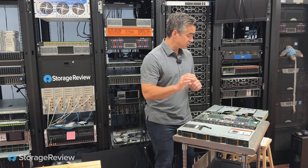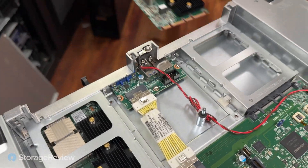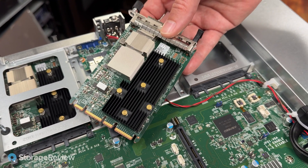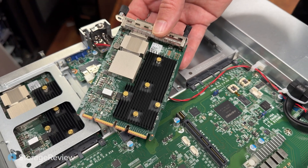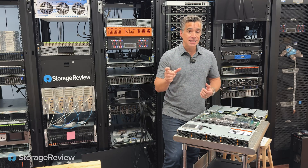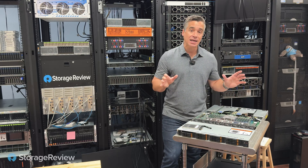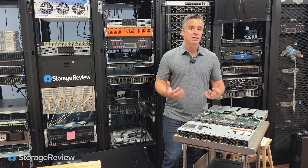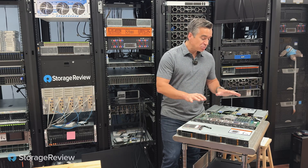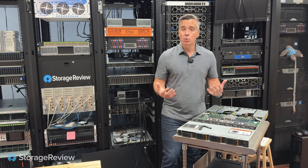We've got all that data in the full report linked in the description. One other thing that's important to understand about this platform is that Supermicro has designed this with two OCP slots in the back of the system. That means that depending on what you want to do with this platform, you could put two high-speed NICs in the back — 100 gig, 200 gig. Now we've got 400 gig NICs in that OCP configuration. You can get two of them in here, and now share up to 80 gigabytes a second out of the box. So it's not just the big numbers inside the box that are critical — it's the ability to get that out of the box as well. And because this platform can be paired with any software, you've got a world of options to choose from, depending on what your workload is.